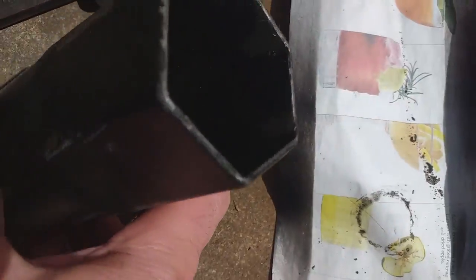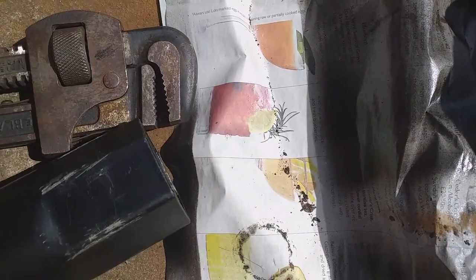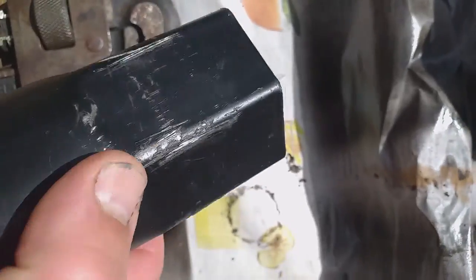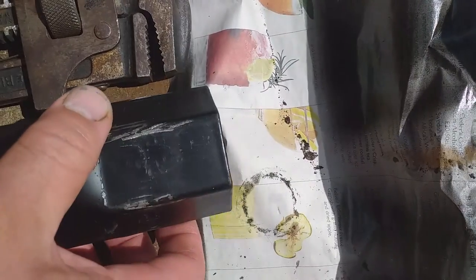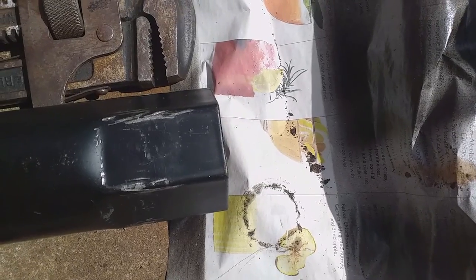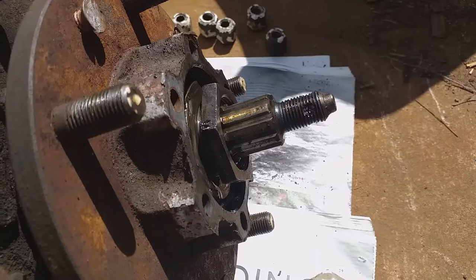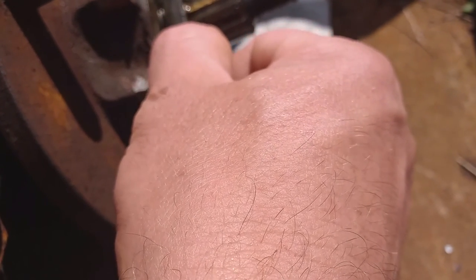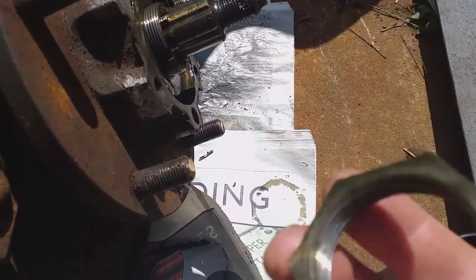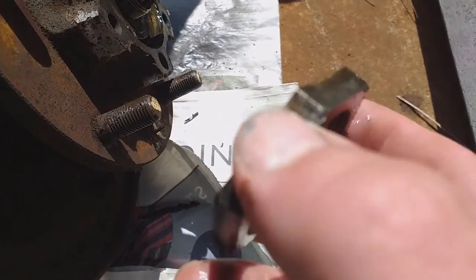For undoing the hub nut I've got this Brickpart 52-millimetre socket, and I use some Stilson plumber's wrench - might need a lever bar on that as well. The last one was really stiff so might need a blow torch to give it a bit of persuasion. It's got evidence it's been loosened with a punch before - I didn't do that. It came undone pretty easily with the Brickpart socket. I'll actually get a new one of these. The two hub nuts are actually identical part numbers.